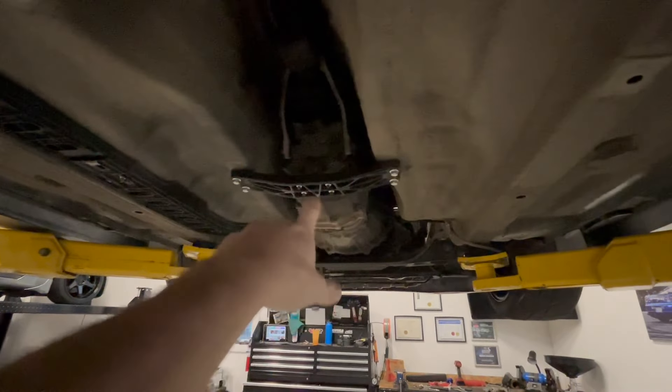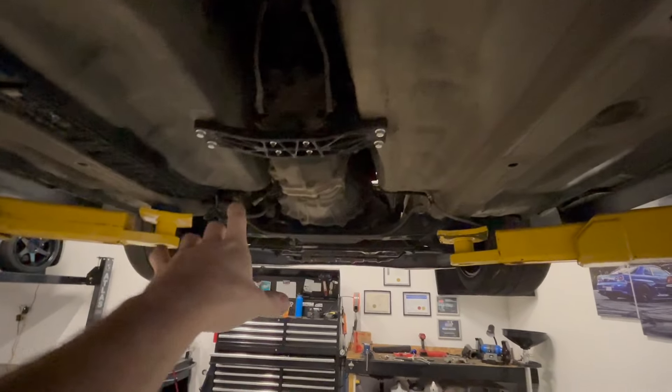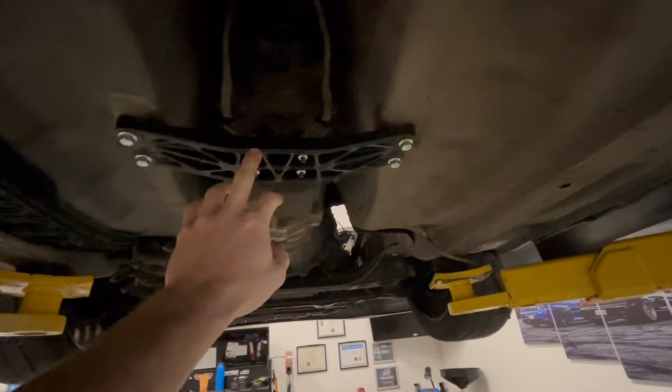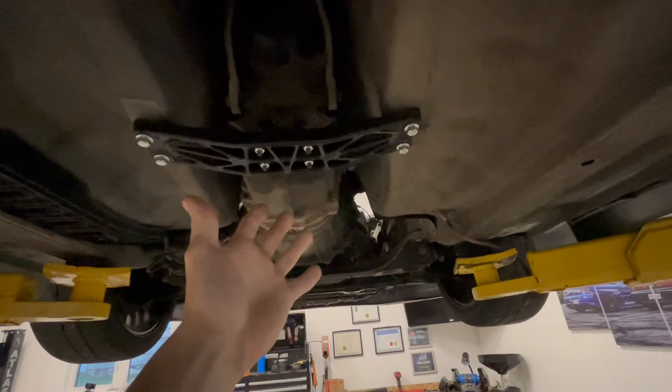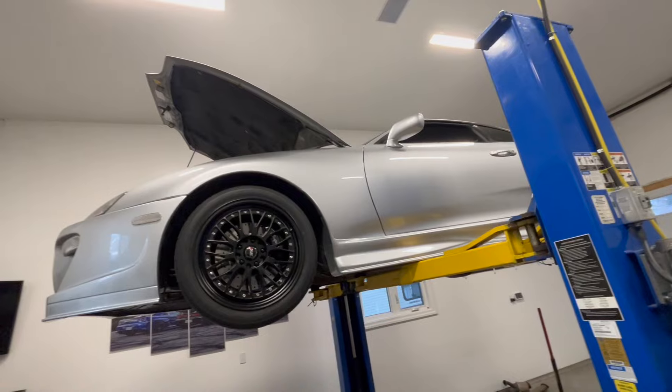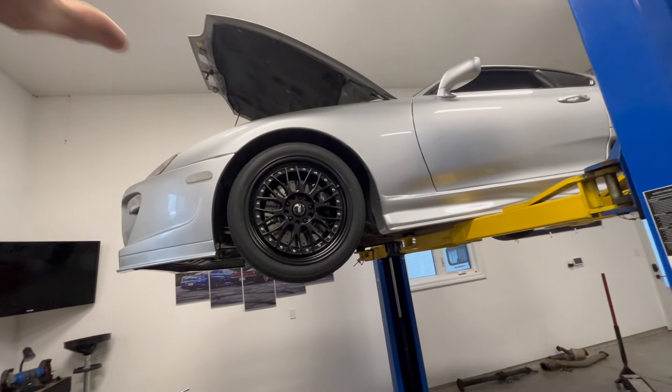Now that we got a few things tidied up top, I lifted it up, pulled the driveshaft out, and I'm just about to pull the old W58 — that's the five-speed — out. I got all the bell housing bolts taken out. Now I just need to get underneath and undo this brace and it should slide right off. Then I'll pull the whole main harness through the top and pull the entire engine out with the wiring harness — it'll be a lot easier to pull the harness outside of the car.